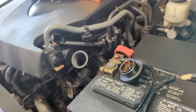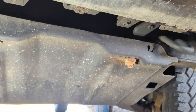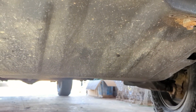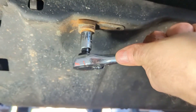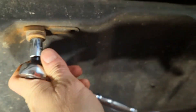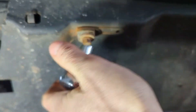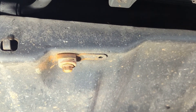Okay, let's get underneath and take this front guard off. We are underneath in the front — there's this big guard here. There's four bolts, 12 millimeter. The back ones come right out; the ones in the front are designed to sort of keep in place because there's hooks here. Just gonna get this off and see what else we can find.